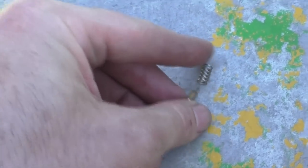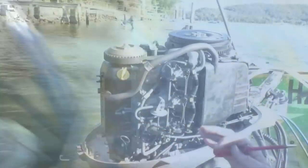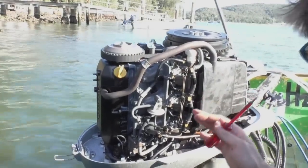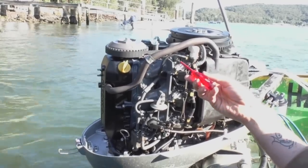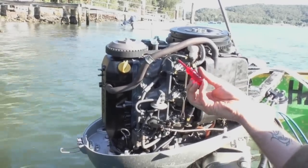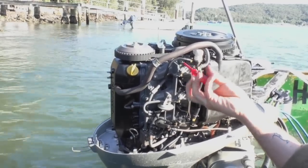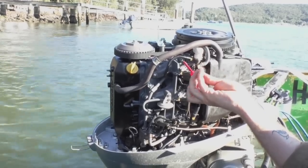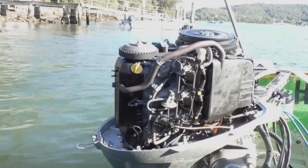I'm going to pop this back in and we'll find a default setting to start with. If you want to take one of these screws out and return it to the same position, the trick is to wind it in first and count how many half turns it takes before it bottoms out. So in this case I might turn it one, two, three, four — say four and a half half turns, so two and a quarter.